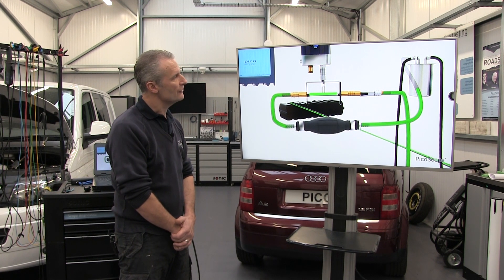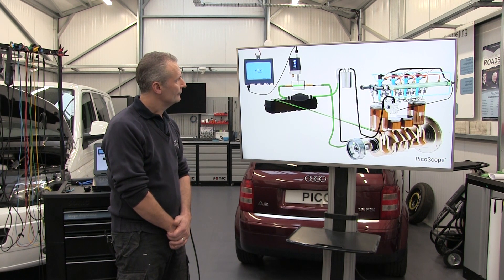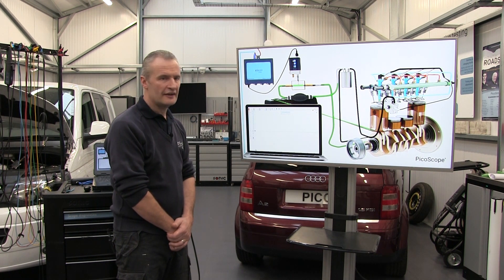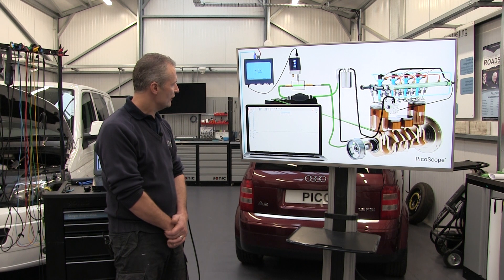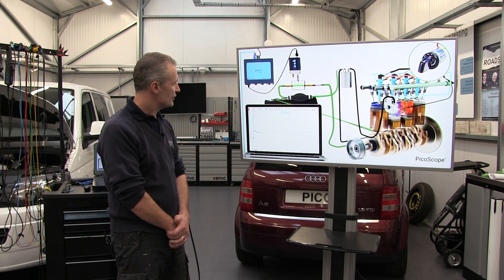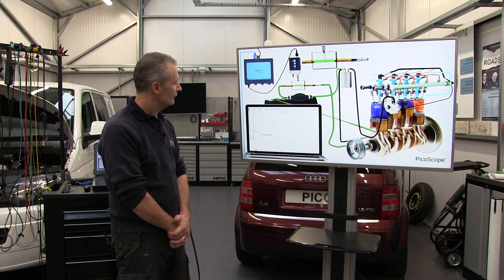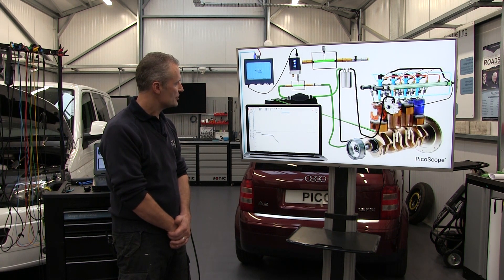You can see there we're pulling diesel through over to the filter. Attached to Picoscope and then we'll start the engine and look at negative priming — the dotted line there denotes atmospheric pressure, and there we have the engine running negative priming. Now we'll close the stop tap.